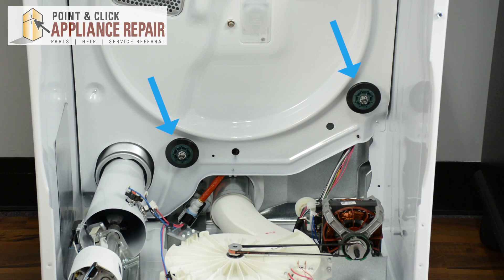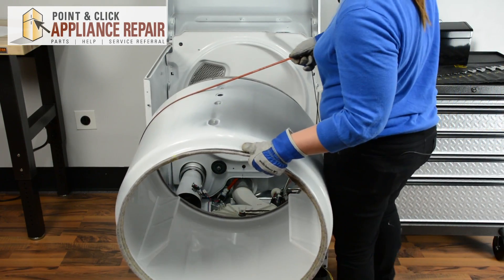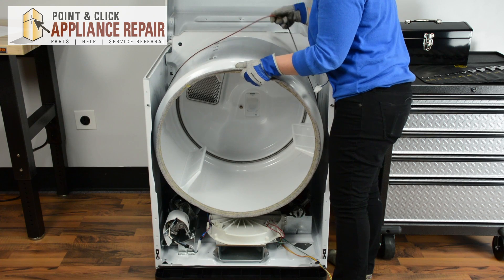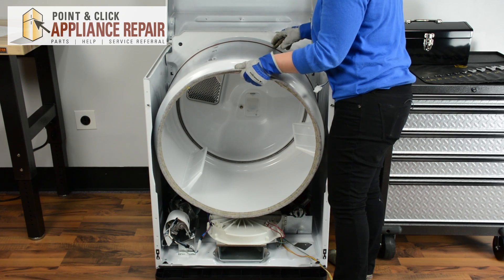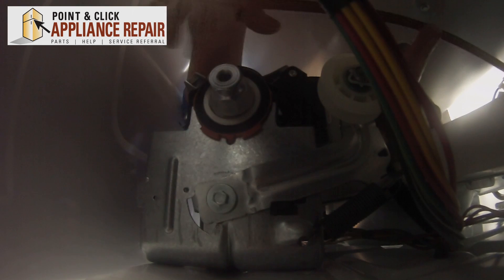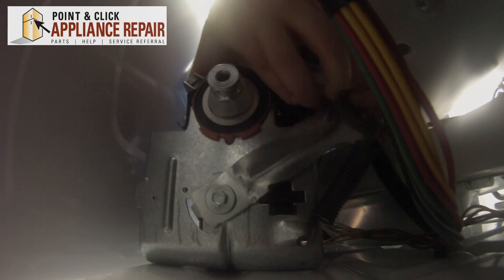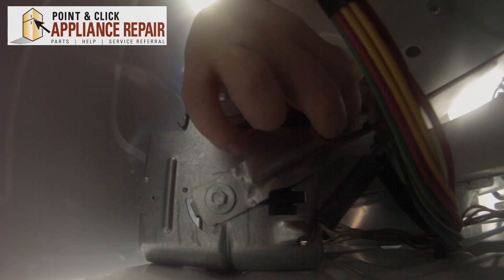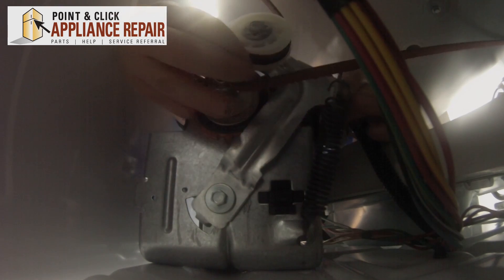There are also two support rollers located at the back behind the drum. Now we can replace the drum by lifting up on the belt and placing it back in the dryer. Make sure that the belt is about three quarters of the way back on the drum and that the ribbed side is facing the drum. We'll need to reach back underneath and lace the belt through the bottom of the idler pulley, then push the idler pulley to the right and loop it around the motor.